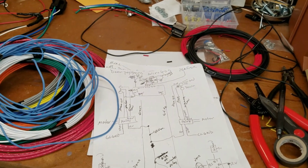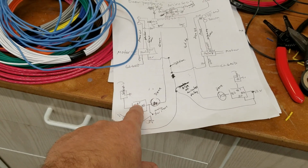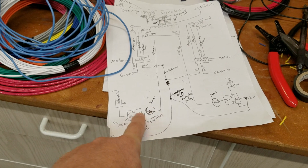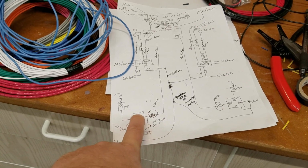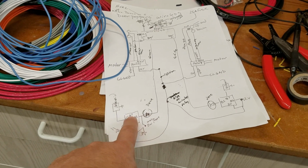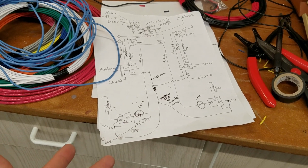That's a nice safety. However, I was sitting there going, well, hold on a second. These are live at all times, ready to trigger. Now, it needs to have a ground switch for it to trigger, which the probability of that is probably one out of a million. But they're still live, which means possibly the door could trigger somehow while I'm driving down the road.